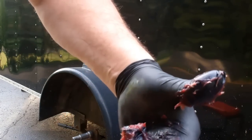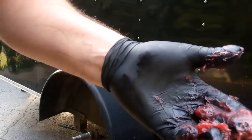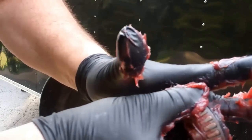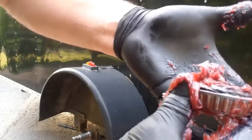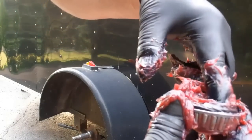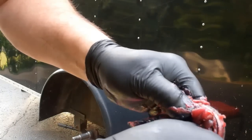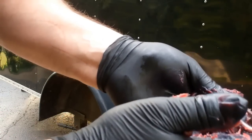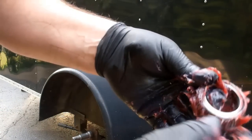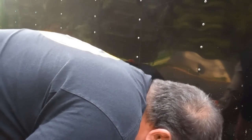Just turn them and this bearing is ready to go — it's nice and packed full of grease. Now I'll do the other one. Any excess grease like this, just get it all together and pack it inside the hub, because that's where you need a bunch of it anyway. You want a lot of excess grease in there, so just get it all together. This one's ready to go.